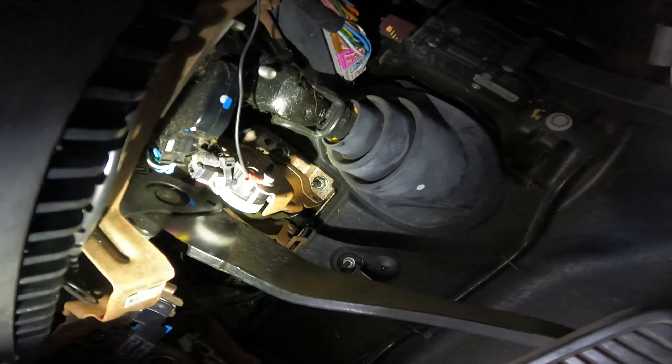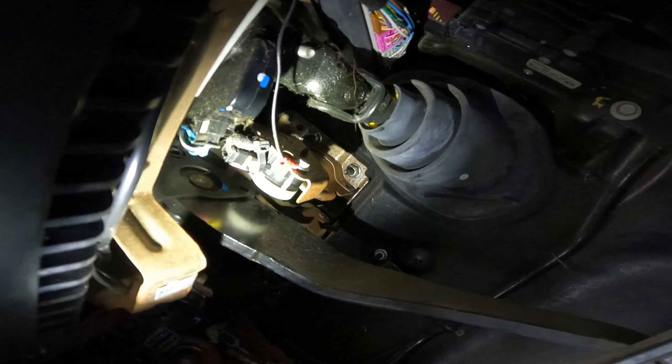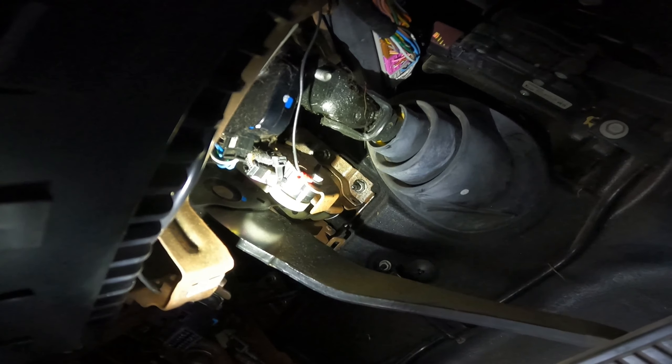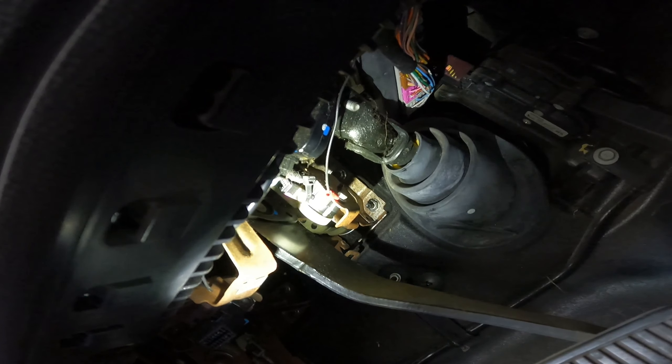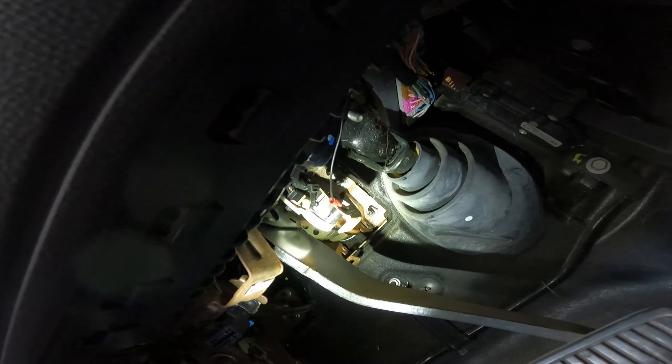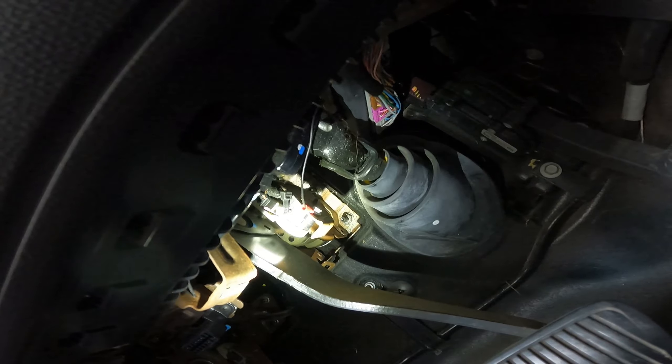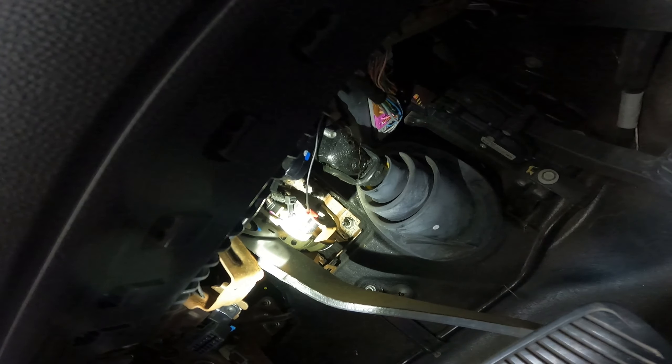I chose to ground the box right here at the brake pedal switch bracket — that's the little red terminal you see at the black wire. I chose to ground there because I had enough wire length and wanted to utilize the ring terminal that came installed. This bracket looks to be mounted to steel. If it doesn't work as a ground I'll move it, but we're going to ground right there for now.